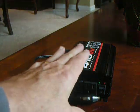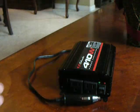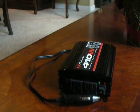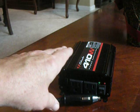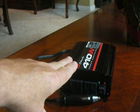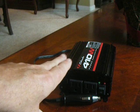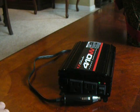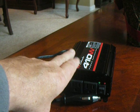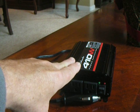By using a single separated battery, that separates the load from this from your golf cart system. The difficulty in using the golf cart directly is if you're in an area that's very hilly and the parade is extremely long, this could drain your batteries enough to where you would have neither lights nor enough power to make the golf cart go and get you back home.